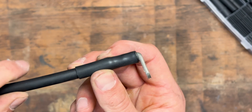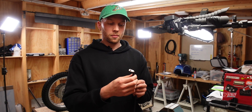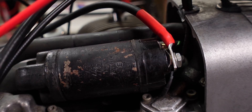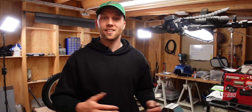So that is what the finished terminal looks like. You get very high quality battery cables with solid connections using a relatively cheap tool, and the good thing is you don't have to solder, which can create a weak spot right after the wire lug where the cable gets brittle and can break. I know people use that method and have no problems at all, but I don't want to risk it, so I feel like this is a very good solution for relatively cheap. I'm very happy with the results and I hope this helps you make your own battery cables. If you want to watch the rest of the BMW wiring, check out that video. As always, thank you very much for watching and I'll see you in the next one.